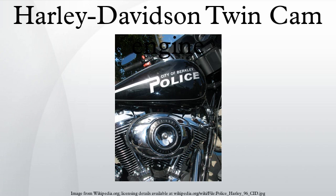This was also partly the reason for soft-tails not initially receiving a twin-cam for the 1999 model year. The early prototype twin-cam engines had considerable trouble with the oiling system, which delayed release of the engine as scheduled for the 1997 model year. When the engines were run, oil came out of any gasket joint as well as the breather. Harley sought the help of Paul Troxler, a young engineer from Southwest Research Institute, and eventually the problem was traced to a design which drained the cam case into the crankcase and used a single scavenge pump. Due to airflow through ports in the crankcase wall, the cam case was not draining properly. After much testing, the solution was to seal the cam case from the crankcase and use a dual scavenge system, which was incorporated into the engine rather than as an outboard pump as used on older big twins since the original knucklehead.